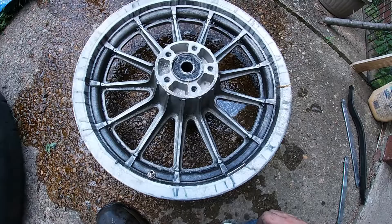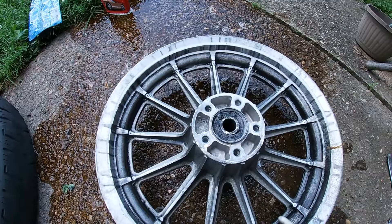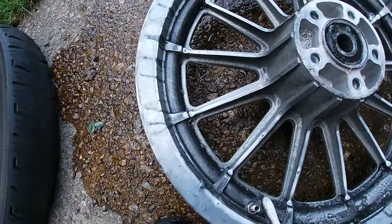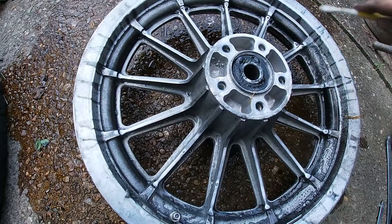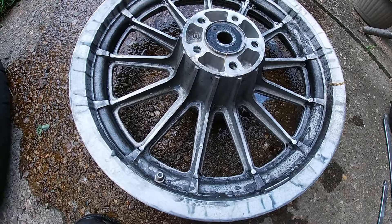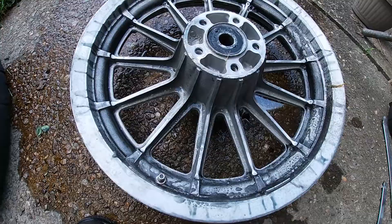Another quick tip: sometimes when you're cleaning the wheel, all you really need to do is just soak it down real good with the degreaser. Then you can just take a brush, real nice and light, and it just cleans up pretty well. And once you hose this off, it's pretty clean. From there, once we get all this cleaned up — which you will likely also have to still do a little bit with the scouring pad, maybe some heavy grit sandpaper — then we're going to go and polish up this rim.